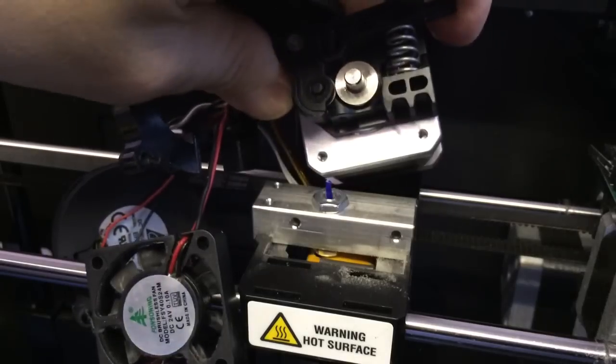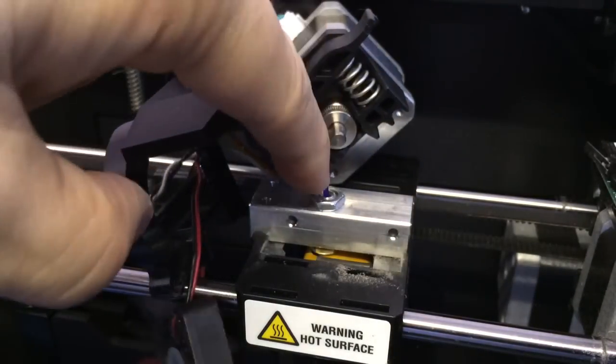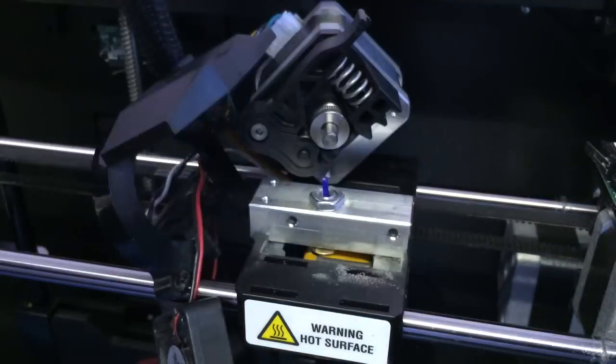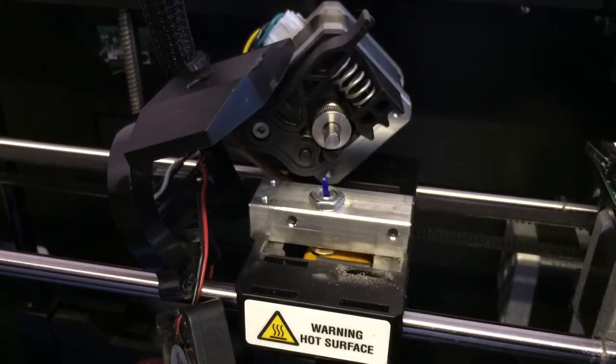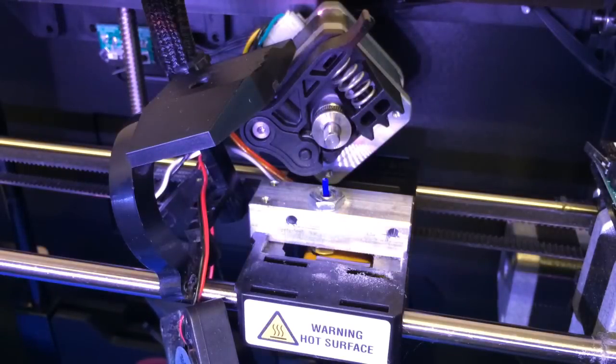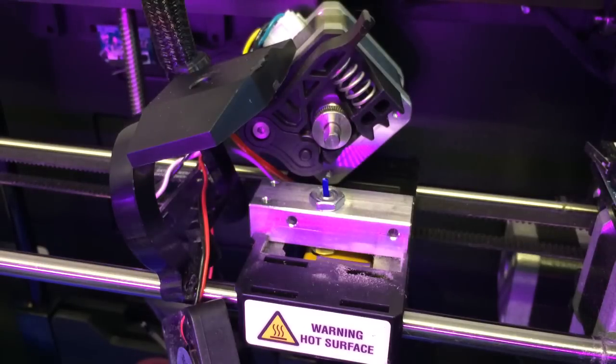This now allows the whole motor to come off. This time it's not a plug in there like last time — last time it was a plug of filament. This time it's a broken filament. I'm guessing this is what happened. So I'm now going to turn the whole thing back on and turn it to preheat, so that this will hopefully get hot enough to let me pull it out. I'm going to put it to 70 degrees — that will take a moment to preheat.